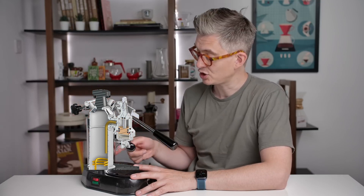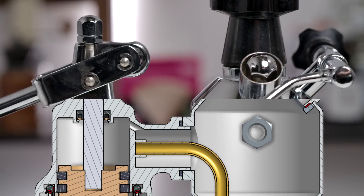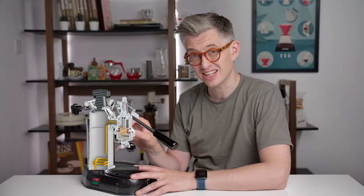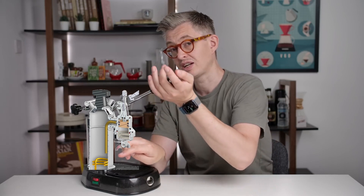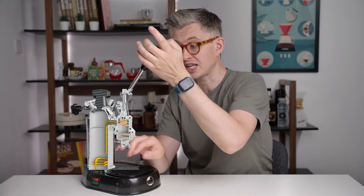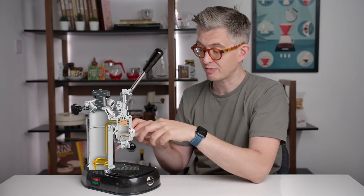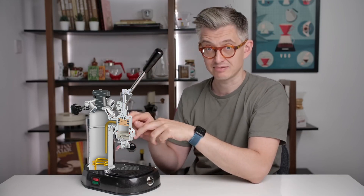So here's your reservoir of boiling water. Inside is a little tube that runs from down quite low in the boiler up through into the group head here. And no water can escape because there's a piston in the way. The way that these things work is when you lift this up, the piston goes up as well, exposing the exit of the little tube in here, meaning water can fill the chamber above the coffee to the piston.